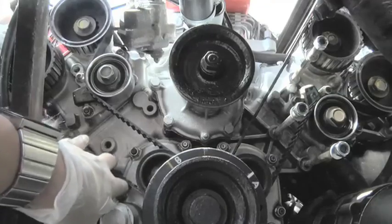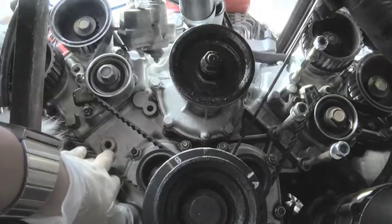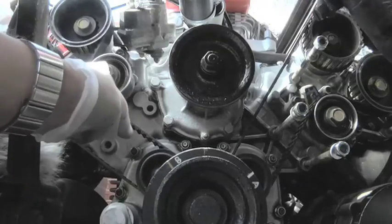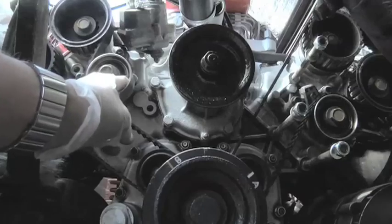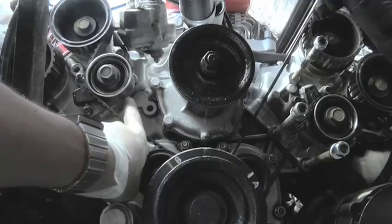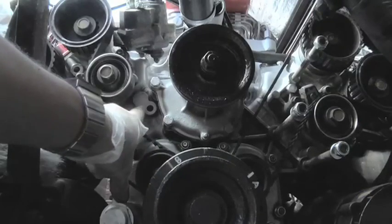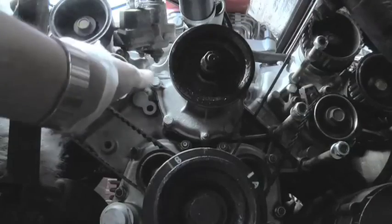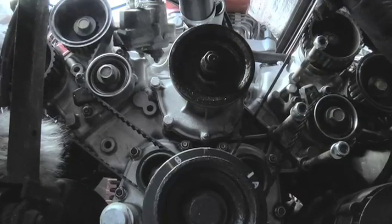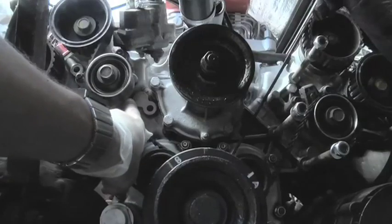There are gauges that pinch the belt and measure the deflection that way - I've seen them used in the US and they look pretty accurate. Then there's the pulley tensioner method, but I don't like that idea. The thing I don't like is you're relying on the spring in there - you slacken it, let the spring tension it, and then lock it off. It all hinges on the condition of the tensioner.